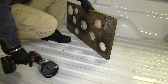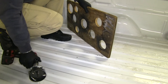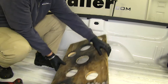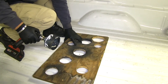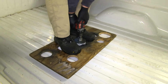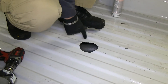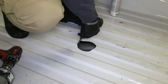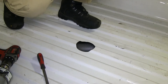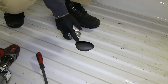Now I'm going to take a four-inch hole saw and open up my pilot hole. What makes it a little easier is to take a piece of plywood, make a four-inch hole in it, set it over the hole, and stand on it — this is going to keep your blade from jumping around. Once you drill your holes, take a file and file the edges to get some of the burrs off. Since this is a white truck, I'm going to take some clear coat and spray it over that bare metal to help resist any corrosion later on.